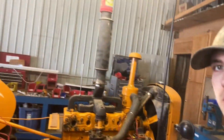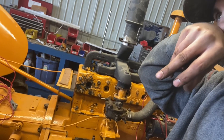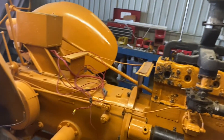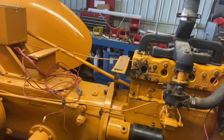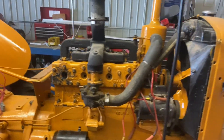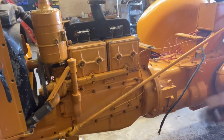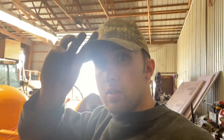Got a lot of it back together. I just have to clean this up — this is where it was stuck and I was trying to press grease and get it freed up. Got everything else on. I have to pull the starter off because I have to make sure this hole's lined up so it doesn't spin when I engage it, and then I have to run some new electrical line for the lights and stuff, because this is all just hacked together — connections were just taped. Otherwise, got this all back together. The only things missing are the hood vent and gas tank. The seat looks pretty good. I'll have to do some touch-up paint where I took the bolts off because it nicked it up, but otherwise it looks awesome — let's see if she'll start.